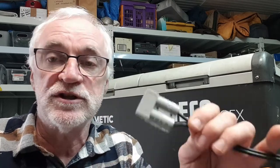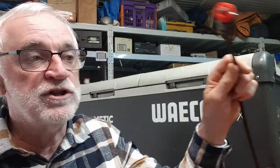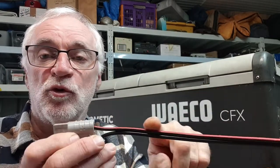Most people who are heavily into four-wheel drives have already switched to Anderson plugs, but you should do it too — get rid of the cigarette lighter plug. I bring fridges in here, plug them onto a power supply, and I cannot fault them. But if I put it on a cigarette lighter plug, I can probably get it to fault. Wire your lead permanently into your fridge. If someone wants to borrow it and use a cigarette lighter plug, have a separate lead for them. Just get rid of it — you'll get reliable performance from your fridge immediately.